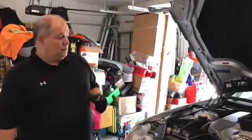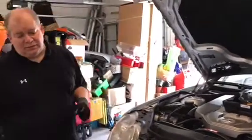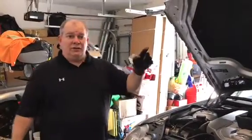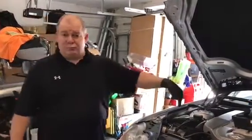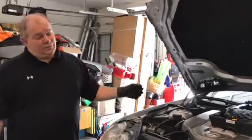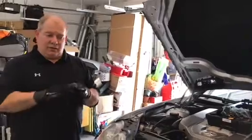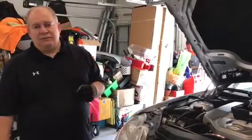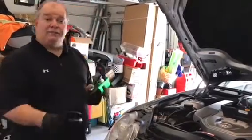new coolant. And for that, we're going to use a vacuum device that I acquired from Schwarzmann for that purpose, which uses the airline compressor using the method of venturi line. You will pressurize the system, make a vacuum. If everything is stabilized, that means you don't have a leak. Then you proceed to fill them up and remove with a vacuum everything from it and avoid cavitation with air bubbles inside. However, not to make it longer, but I think it's pertinent, there is one side effect on this that I have to at the same time fix.